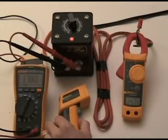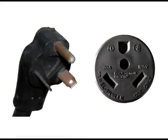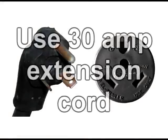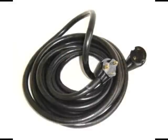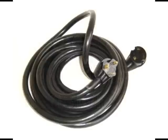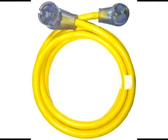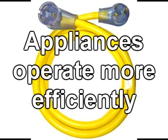The lesson here is that you should use an extension cord rated for the maximum amps your RV can pull from the power pedestal. So if you have a 30-amp shore power plug on your RV, you should use an extension cord rated for 30 amps. Don't use multiple extension cords to extend the length of run if possible. Your best choice is a heavy duty 25-foot 10-gauge extension cord rated for a full 30 amps of current, which will result in very little voltage drop. This will cost you a little more money, but that's well worth the expenditure since it's not only safer from fire hazards, but your RV appliances will operate more efficiently.